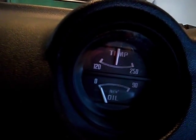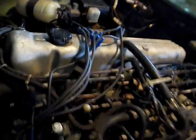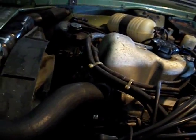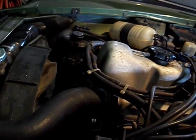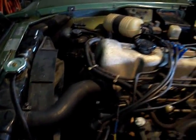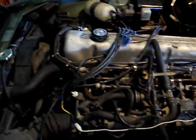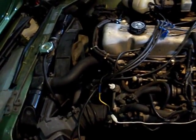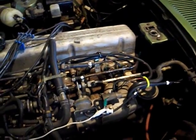The next part of the process will be the hard part: I'm going to remove the temperature sending unit. I'll probably have to remove the top hose at the very least for better access, put the sending unit into a pan of water, get an accurate thermometer on it, heat it up to 185 degrees, and see if it reads 40 ohms. If it does, then the sending unit is working correctly. If not, that has to be looked into. I presume the sending unit is where the issue is going to be — I can't imagine the gauge or wiring harness being the problem, but I guess it's possible.